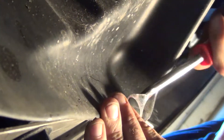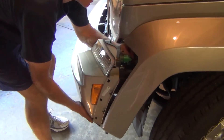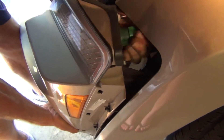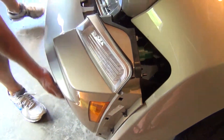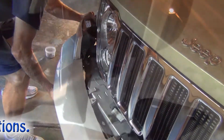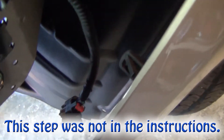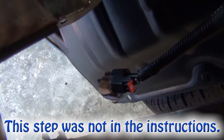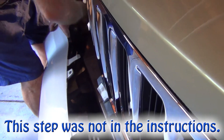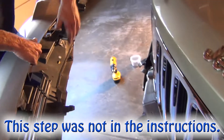And this is the one they're talking about — there's one on each side. You've got to kind of twist these out; they're pretty much not reusable. Then you've got to slide the red lock back and just disconnect the light there. Do the same thing on the other side. There was an additional light to pop out as well. To get those out, just grab hold of it, twist up, and pull back. The front bumper cover is now removed.